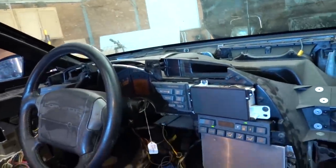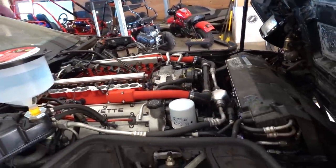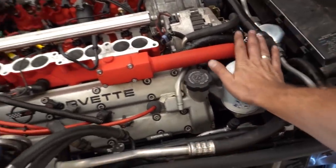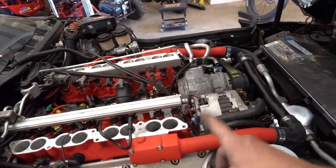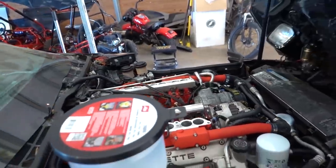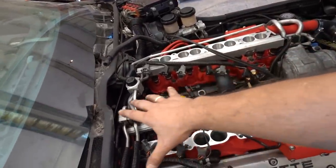We're giving the starter a little chance to cool down because we weren't seeing oil pressure on the gauge yet. Speaking of new gauges — we had to get those because all the electronics in this car were pretty much fried from the flood. We're letting it cool a little bit, then we'll run it again to see if we get some oil pressure. We're still trying to burp coolant because apparently these LT5s are notorious for having a lot of air and taking forever to burp out and fill up with water. Once we get oil pressure going, we'll put the top on, connect all the injectors, put the plenum on, plug everything in, and it's start time. Problem is it's the end of the day right now.